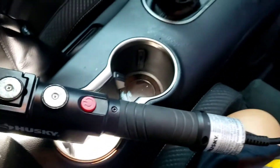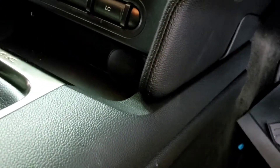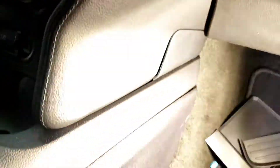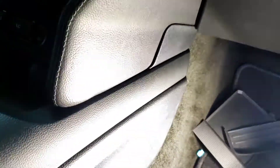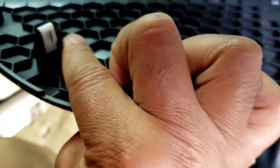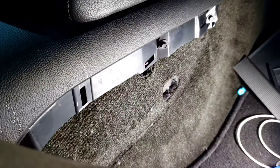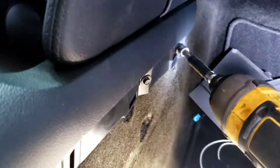Once you got that, I can feel this thing right here. Now this part right here is plastic on the left, the right side — passenger side. Trying to pull it out like this, it should come out pretty easy. It's only plastic, there's four — five — little tiny clips. Once you get that, this seven millimeter you have to take out right here, because this whole piece is gonna come out separately. Take that seven millimeter out.